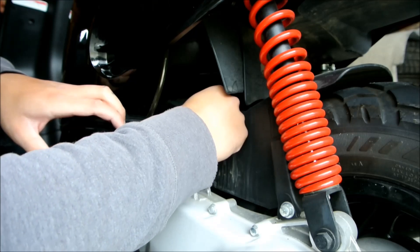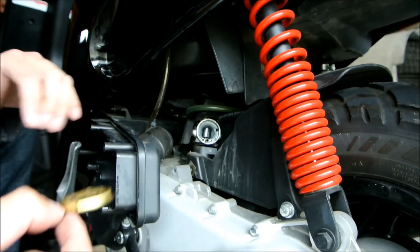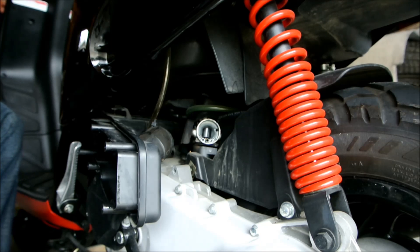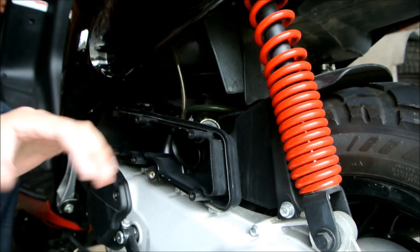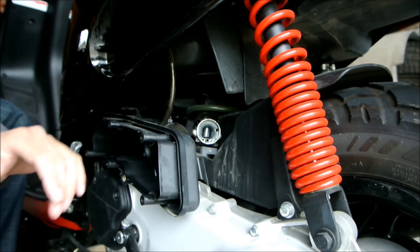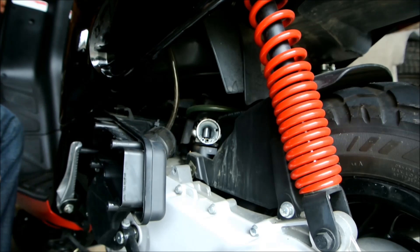If you open this up and just take it out, it should improve performance by quite a bit. With your entire setup removed and the restrictor removed, you will need to do a little jetting — that involves taking this carburetor out and doing a little bit of tuning.